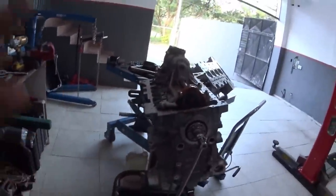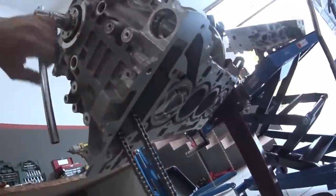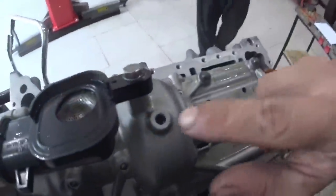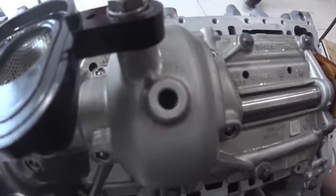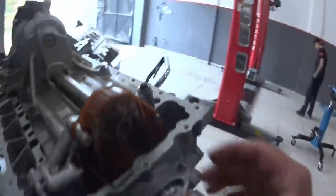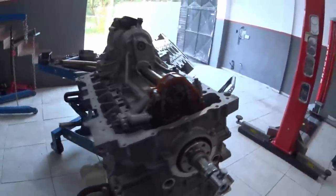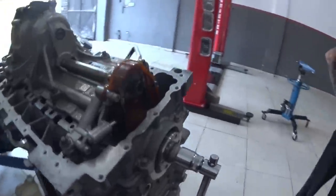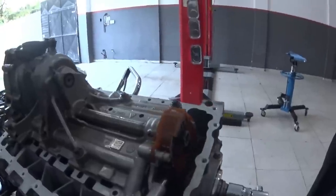Now it's time to install the oil pump. First piston at TDC. You can see it there — TDC. What is the reference point for the oil pump? This little hole here. You put a pin in there — it locks. Piston at TDC, come here and fit this gear. Then you just torque this bolt that goes here and that's it. Everything is correct. Then after everything is set, you pull the oil pump chain tensioner, and you have a synchronized oil pump — everything perfect.